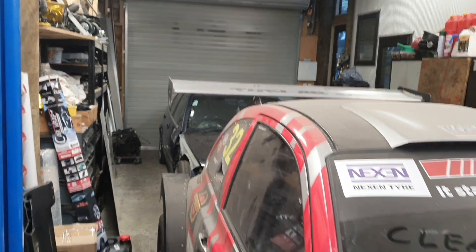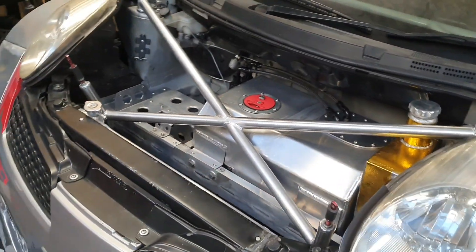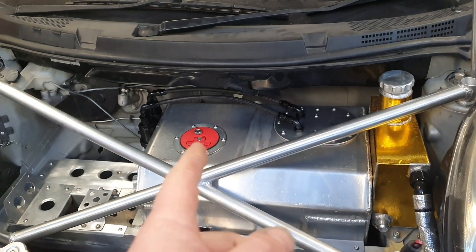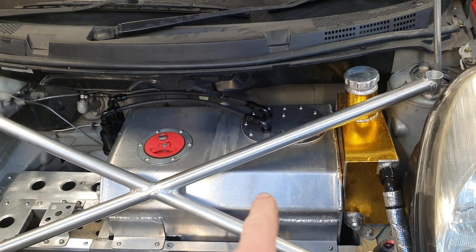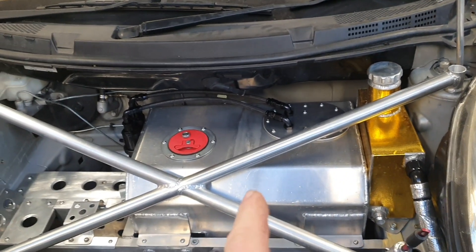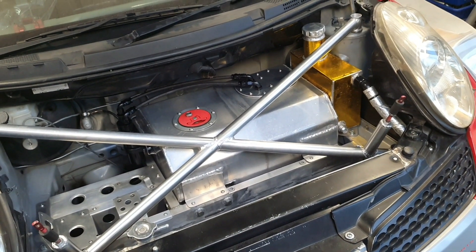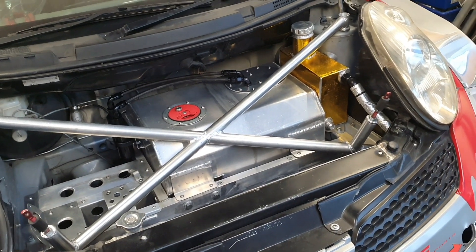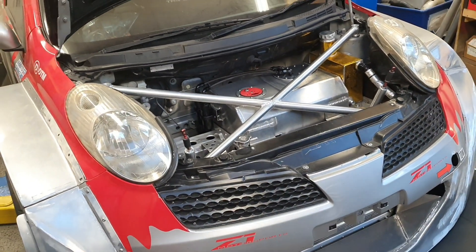The BMW over there - I've noticed one or two of those hoses were done rather poorly, not sure who did them, but they need to be resolved. Anyway, that tank is now slightly bigger than the other tank so I've measured it all up - it's just simple mathematics. You measure this distance here and that distance there and that distance there, you can do it accurately or just average it out if you've got funky corners. Times that by that by that - that's about 34 liters give or take. We got four more liters than what we had before, so if we're running at Pukekohe we might get another lap, but 34 liters is plenty for what we do with superlap.